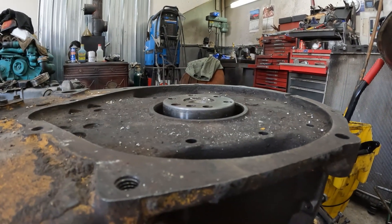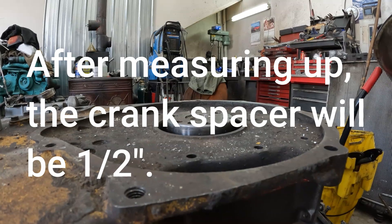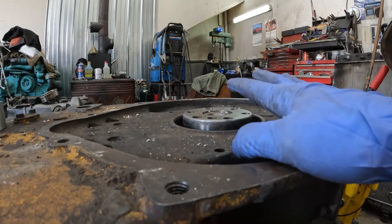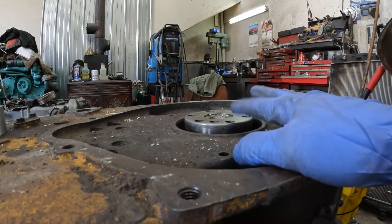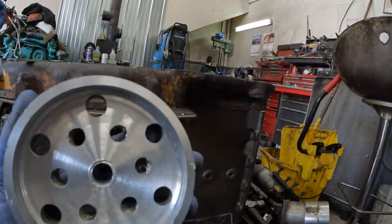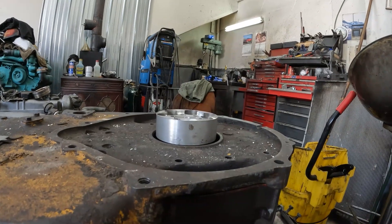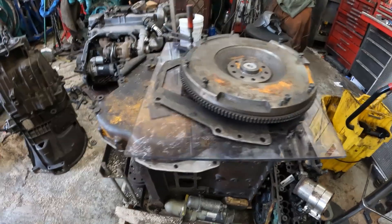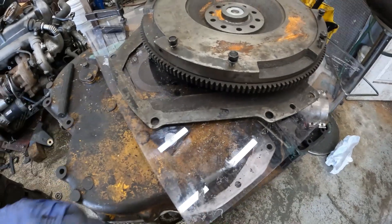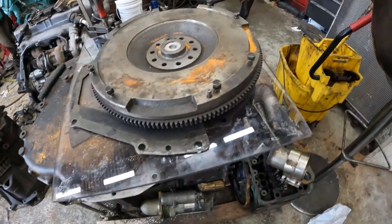So the spacer plate will be a quarter of an inch instead of a half, and I like that a lot better. I'm going to work with this for now and then see what I think when it's all said and done for the spacer. Because right now we have an inch, and that's got to go a lot shallower than an inch. We've got the plexiglass down, we've got the ZF6 adapter in place, and we're just going to sit the transmission down and see how that looks.